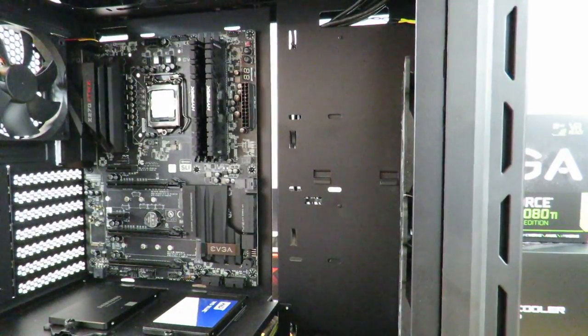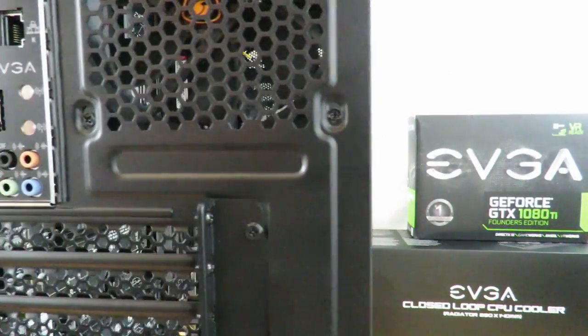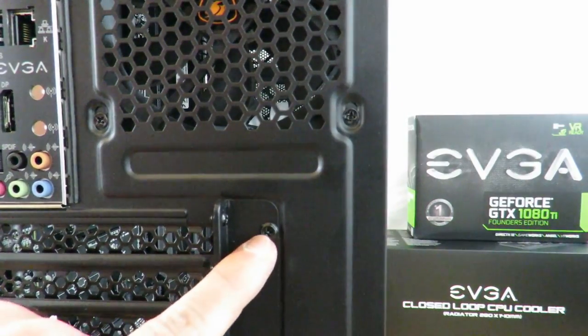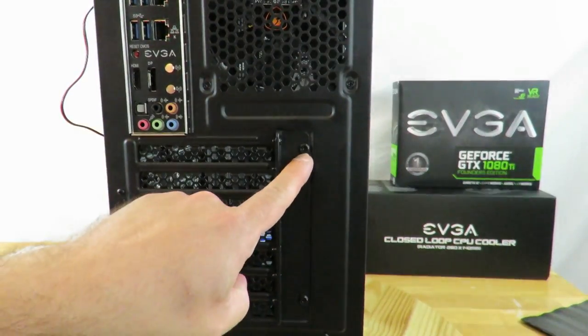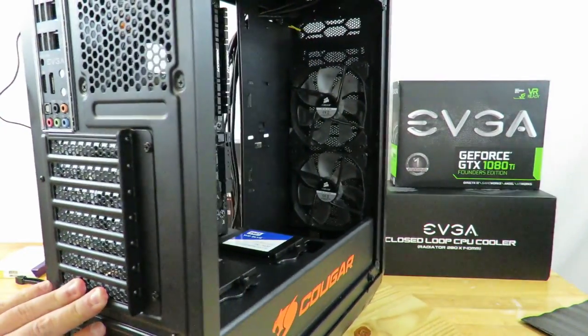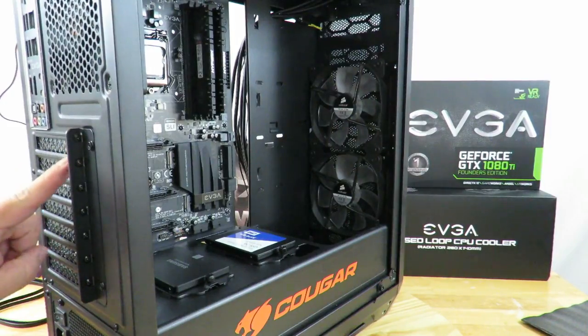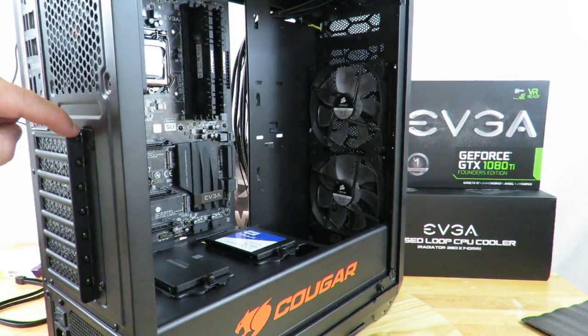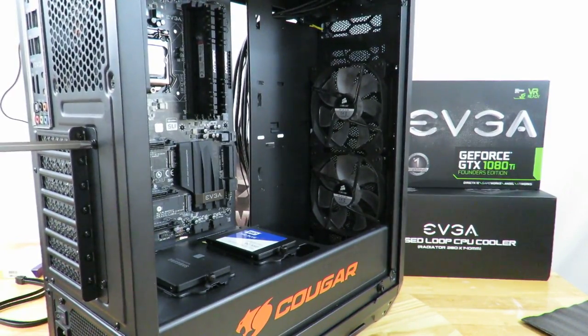the video card. Now, in most cases, you would just come inside the case, unscrew these two screws, and take out these two I/O covers. But in this case, it's a little bit different. You have to unscrew these guys, and let me zoom out. You have to unscrew here and unscrew here to be able to take this housing out so that you actually have access to the screws, which are on the outside. So I'm going to go ahead and just open that up.